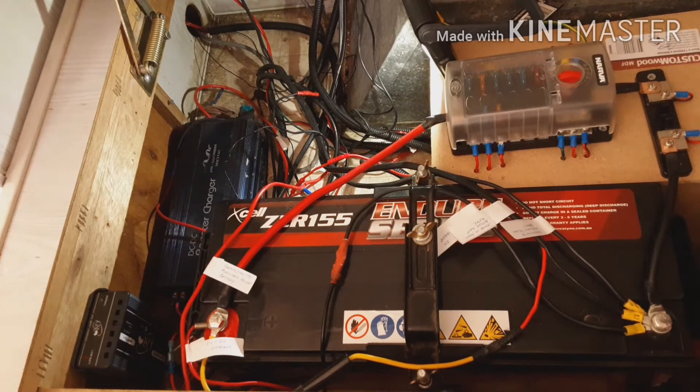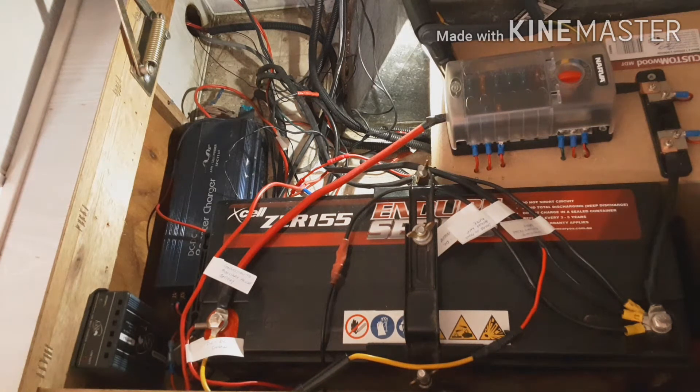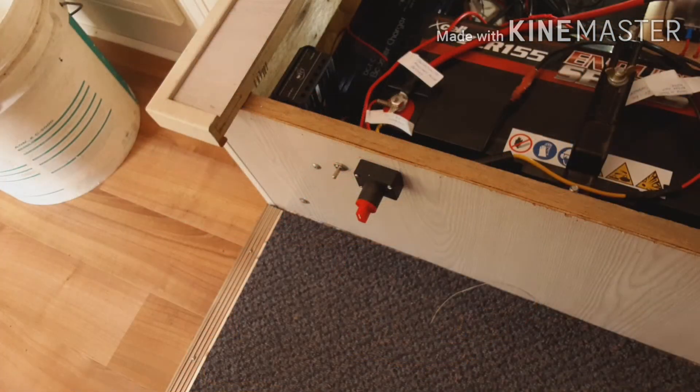Just before I run through the wiring I'll show you my present setup and give you an idea of how I'm powering this DC-DC charger. My present setup in my van consists of a 30 amp DC-DC booster charger that charges the main house battery shown here from the car's alternator. Near the bottom left with the flashing light is the solar regulator which controls the charging from the solar panels. As well as the 155 amp hour house battery, I have on the other side of the van a 100 amp hour standby battery which has its own independent solar charging.